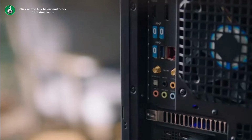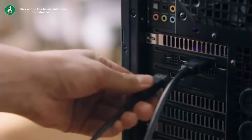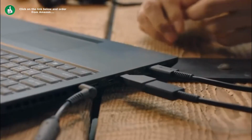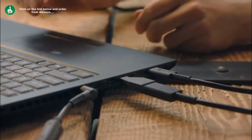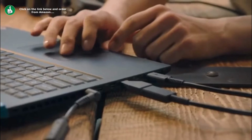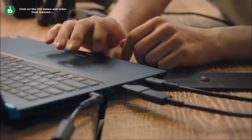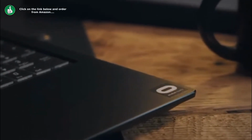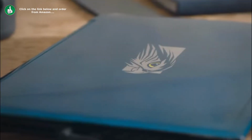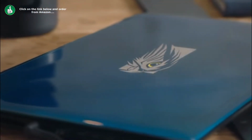First, plug the USB cable into a compatible 3.0 USB port, then the DisplayPort into a dedicated graphics card port. For laptops or older graphics cards, Rift S also comes with a mini DisplayPort adapter. If you're using Rift S on a laptop, keep your charger plugged in to avoid performance issues. When using a laptop with Rift S, it's important to ensure your laptop is Oculus Ready certified. We're using a certified Falcon Northwest TLX laptop, perfect for Rift S.